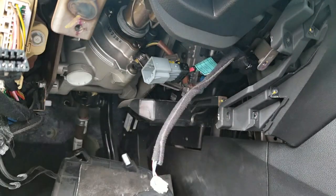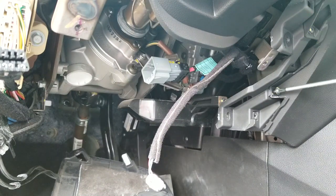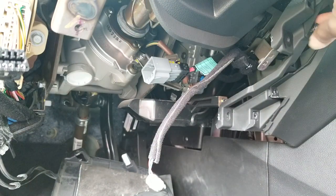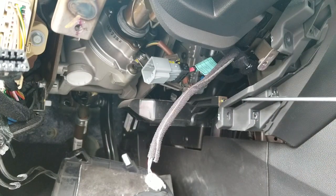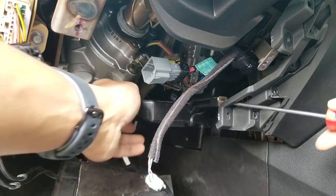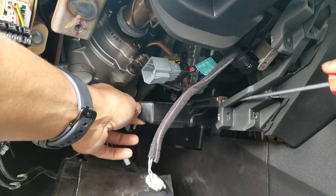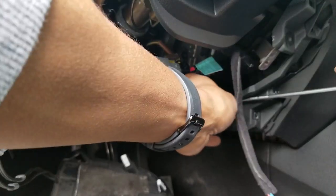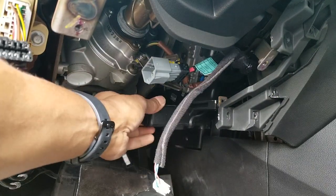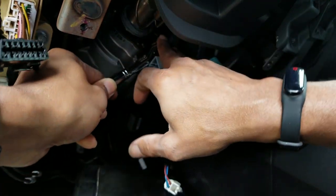We're also going to remove this as well. We need to hit these screws because we need to remove this screw. See this AC — it has to come out, because if not, when I lower this steering column it's going to crash into the AC duct. So that just comes out. Let's try an eight millimeter socket and get this thing off.